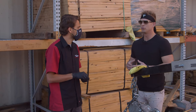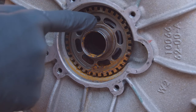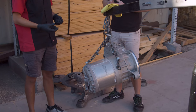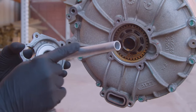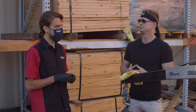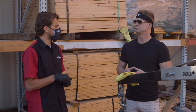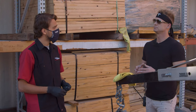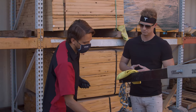Can you tell me in general what the symptoms of this issue are? So one way you can tell if you've got this problem is to remove the encoder and look for moisture or coolant actually in there. You'll either see it building up so that when you pull out the plug it leaks out, or you'll find droplets inside. The other way is if you have a low coolant fault that shows up but you don't see any pooling of coolant under or around the car — that's a pretty good indicator the coolant is going into the drive unit.